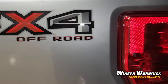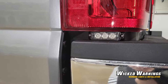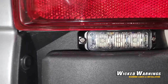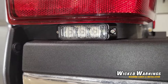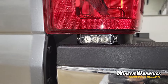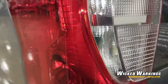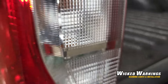This is that side tail light mounting I was talking about. Sometimes you have to drop the bumper a little if somebody had set it extremely high; otherwise, it tucks right in there and is mounted on the plastic. You can mount a TIR-3 there, a LIN-6, or a SoundOff MPower 3 — there's a lot of different lights that fit. Our favorite is the TIR-3 or the LIN-6, but the SoundOff also fits there as well as many others. The hideaway light is inside there, mounted from the side — you can't really see it.